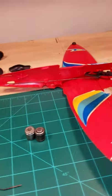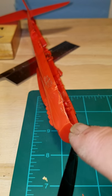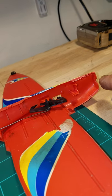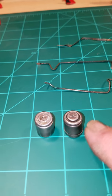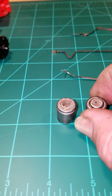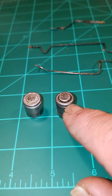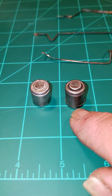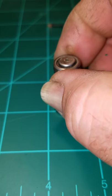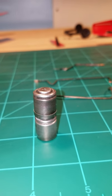That's pretty much everything that's inside. It's not a hard process to take apart — you just have to be really careful when cutting the front with the razor saw, making sure you make a nice even cut so you can glue it back together. I went online and found quite a few companies that carry one-third AA cells. They're hard to find NiCads, so I ended up getting 280 milliamp nickel-metal-hydride batteries. The company will even tack them together — the new cells — to make the pack the way it's supposed to look.